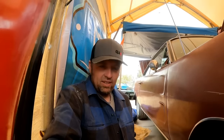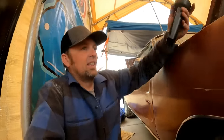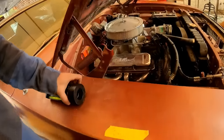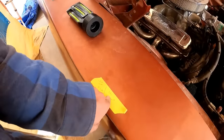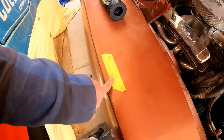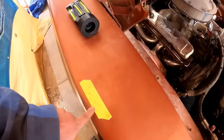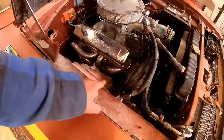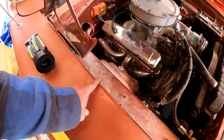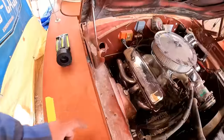I want to take some camber out of it and add caster. So let's see. Don't do this if it's a painted shiny car. I've got 3/4 degree camber. 2 degrees. Oh yeah, we lost caster because I said I had to do that bolt over there. So we can't max out that anymore. So I'm gonna bump that guy out just a tick more.